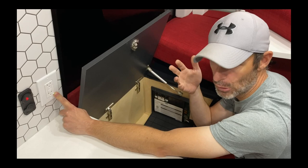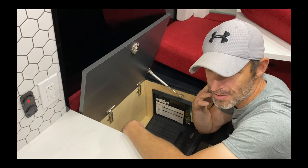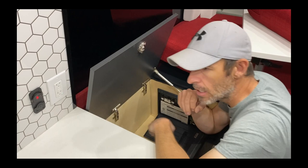Once we drive the van it re-energizes — it will put in about 600 to 900 watts an hour and you have a 3,000-watt system, so if you drove for three and a half hours it would basically fill it from empty.